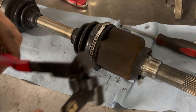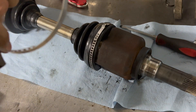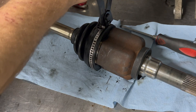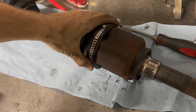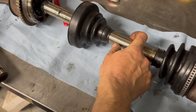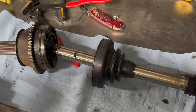Then you take these clamp tools — see that little piece right there — they just go in there like that, you squeeze and it pulls the clamp tight. That is on there. Keep doing that for this section, make sure you're inside that groove, then repeat the process for the other side. Same thing — make sure you put a bunch of grease on the outside before you put the boot on so you don't have any issues. That's pretty much it as far as the axles go.